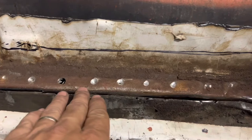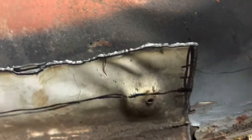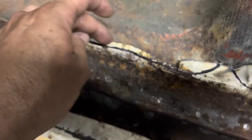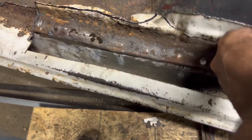So I've trimmed this piece off and trimmed it down to the length I need. I'm estimating — I need to cut right about there, and I can look behind this and see my cuts down there. I'll play it safe and draw a little line there. I know I'm going to have to add a little filler metal here, because remember — this is the piece of the floor that was already gone, somebody had already cut that, so I have to fill a little bit of that space.